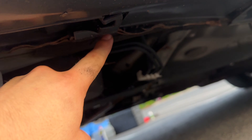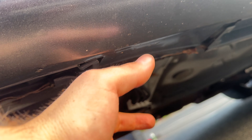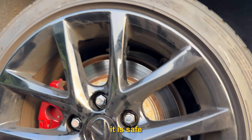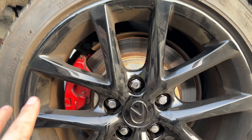These are the points where I ended up placing the jack with that hockey puck. Someone already damaged mine from jacking it up improperly before. We placed them here — hopefully that's safe. We're starting with this side: take the lug nuts off, remove the tire, place the tire underneath as extra safety, then we can start working on the rotors and brakes.